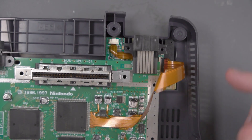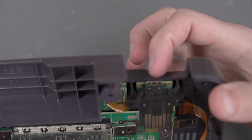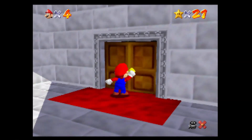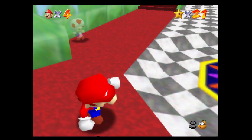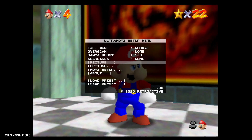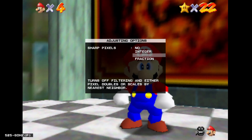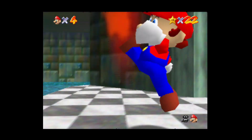Before I put everything back together I'm going to test this console, both the analog output as well as the HDMI. Everything looks okay through the HDMI output. What you're seeing here is the fraction sharp pixels mode in the picture settings — it seems to make the picture take up most of the screen. If we go into the Ultra HDMI menu and change to the Integer sharp pixels mode, the video only takes up about three quarters of the screen at 1080p.